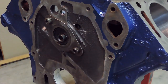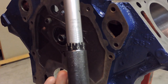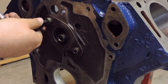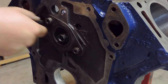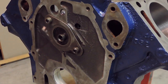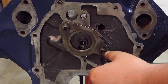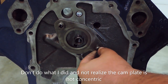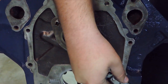I'm going to go ahead and grab the torque wrench here, which, as I stated, is set right at 20 foot-pounds. I'm going to go ahead and tighten these guys on here. And these are going to want to try and cam out on you, so I'm probably going to move you guys over here a little bit. Move you all this way. Get you guys a straight-on view. And these are a number 3 Phillips on these. And like I said, I'm going to have quite a time trying to get these to not cam out on me here.